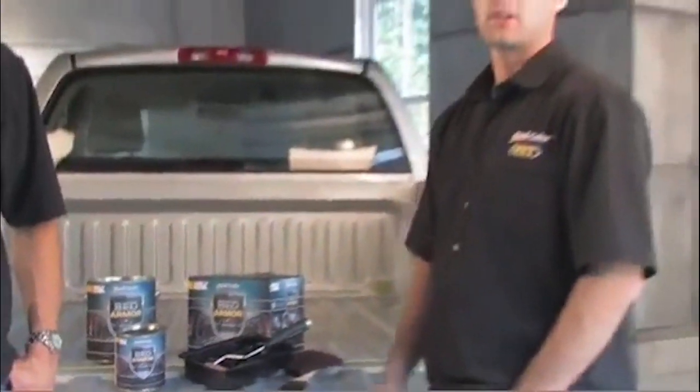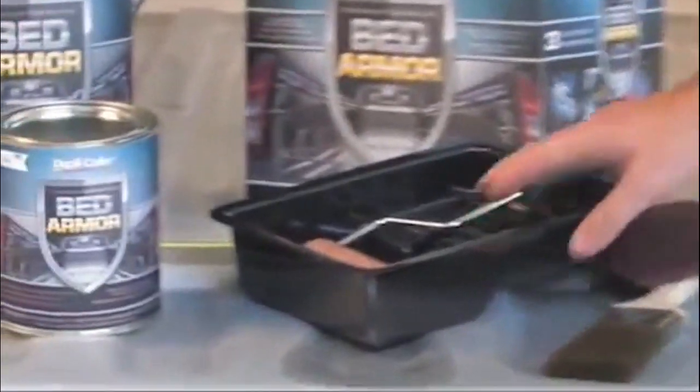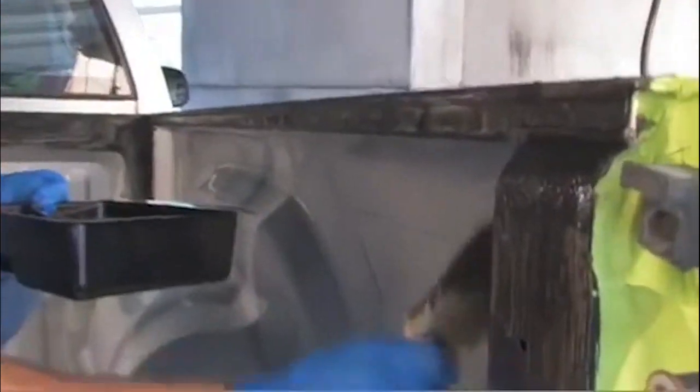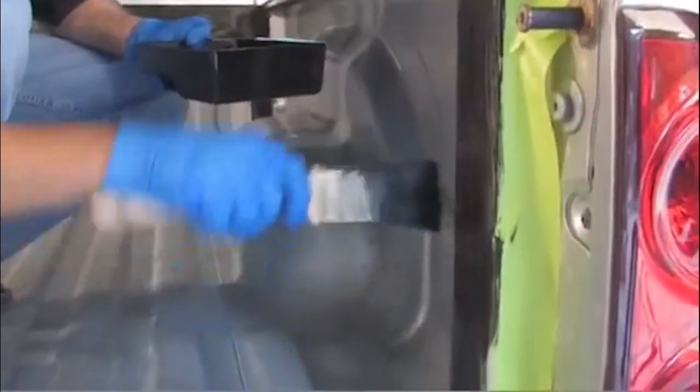We're on step two, which is the application. With our complete truck bed protection kit you'll find all the tools you need to complete the job — we started with our scuff pad, and we also have a roller tray, a roller, and a brush for any of the cracks or crevices you might run into. The BedArmor protection kit comes with plenty of material to handle the job of a full-size truck with a six-foot bed. If a truck has an eight-foot bed, you'll need to get the extra quart, which is sold separately. The brush is great for the edges because you can get more control and a thinner amount of product than you would with the roller, which really bunches it up, so the brush is great for edges and any cracks or crevices.